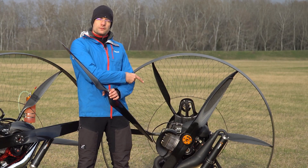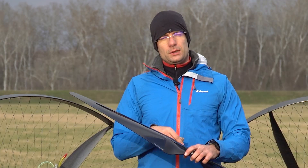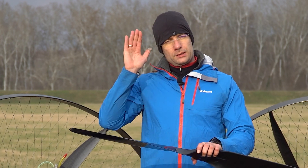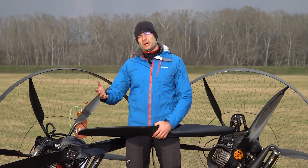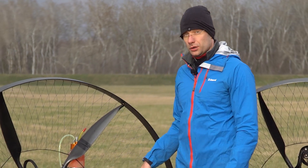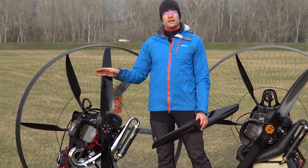Comparing the performance of this motor with the Factory R and the 130 prop, we will know how much extra power or efficiency you gain from the Factory engine. And then comparing the performance between the 130 and the 140 propeller, we will find out how much extra power or fuel efficiency you gain from the additional 10 centimeters in prop diameter. I mean, it's huge.